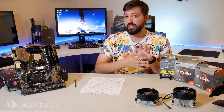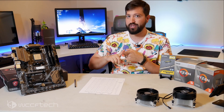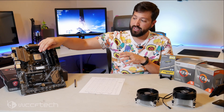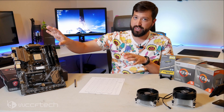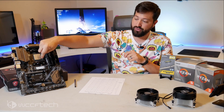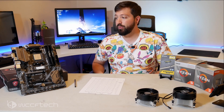These APUs do not support PCIe Gen 4 — that's a Zen 2 feature, starting with the 3600 and up. You only have eight PCIe Gen 3 lanes, and if you use an NVMe drive you'll take up a good portion of those, leaving very little for a GPU. So use a SATA drive, or use NVMe only if you don't plan on using a high-powered add-in board.